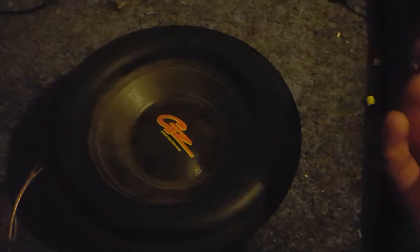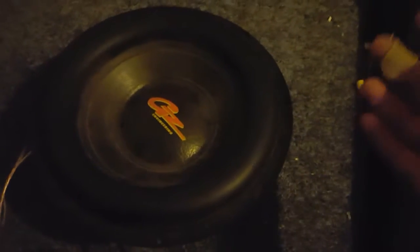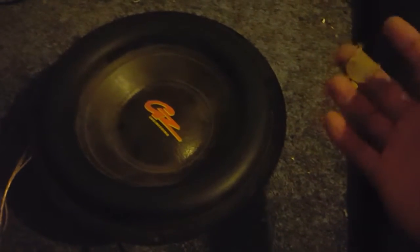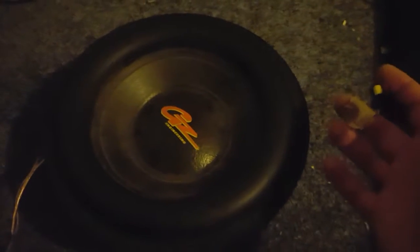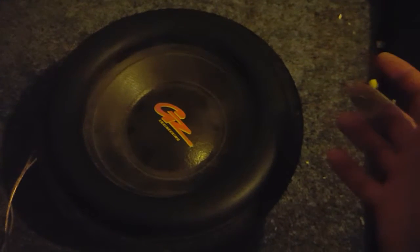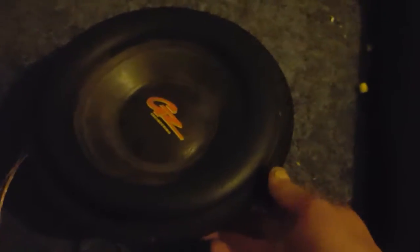GZ Engineering 10s. He gave me a box — the box was beat. It had gotten wet, separated on the sides. That's what made the Planet Audio sound bad, which is how I got them in a deal, but there's actually really nothing wrong with them. I'm going to take the box apart, go buy 3/4-inch plywood, rebuild the box with 3/4-inch plywood, put these in it. It's a box with a 10 on both sides and one of those great big square ports in the middle.